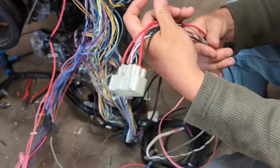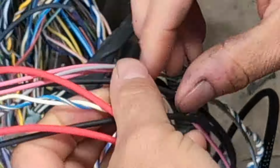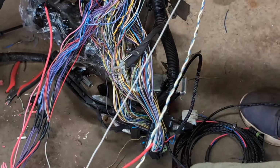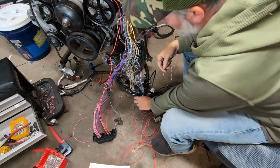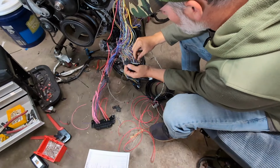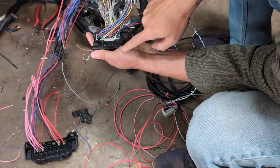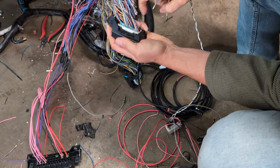Next, you'll grab this part from us, and all you got to pin in is CAN bus and fuel signal, okay? The CAN bus, you already have your CAN bus wired in here, but that is a different network. So anyways, we're going to go to the other side of the connector. This is where we just did the sensor. You're going to rotate it. Now we're on the outside edge.